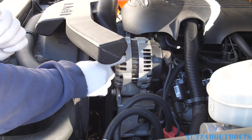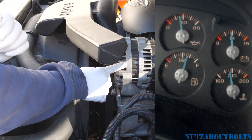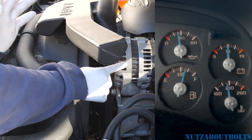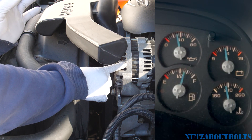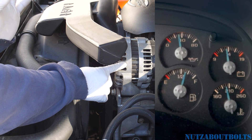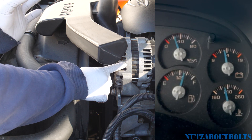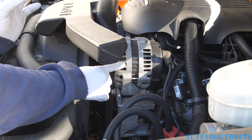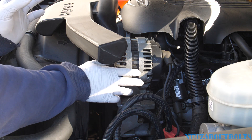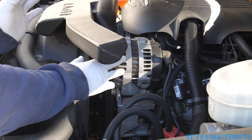When you open your engine hood, the alternator is on the right side. The reason I'm changing the alternator is because the battery is not maintaining its charge. The battery gauge should be maintaining at 14 volts, not 9 volts, or fluctuating between 14 and 9. If you're driving and you come to a complete stop and your battery gauge was at 14 and then dips down to 9, you know your alternator is bad — and when it dips down to 9 you'll see the battery light flash on as well. Also, when you put a load onto the engine, like turning on your AC at idle, it'll fluctuate from 14 to 9 or dip down further. That's when you know your alternator is bad and needs to be replaced.